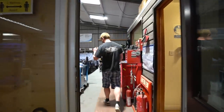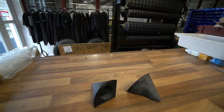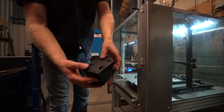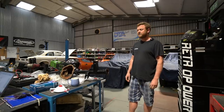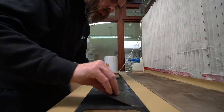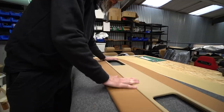James has been doing a lot of CAD work this week and the 3D printer's been busy as well. We've been doing a lot of interior work for the Kaiser Mercedes — things like tweeter pods, speaker grill inserts, and rack dummy mounts for the Mark II Jag. The 3D printer's been printing various interior parts which we're now in the process of upholstering. For instance, the parcel shelf — we've made the main shelf in MDF which has been leathered by Dean our upholsterer, and we've 3D printed a speaker grill insert wrapped in speaker grill cloth, which holds the cloth and stops it sagging over time.